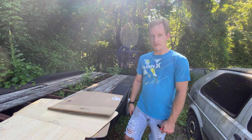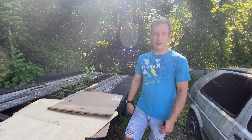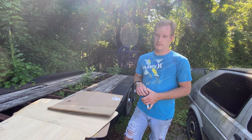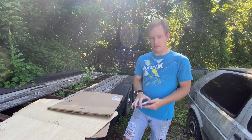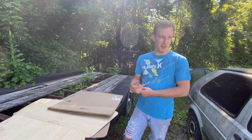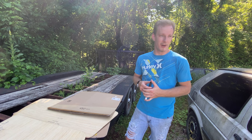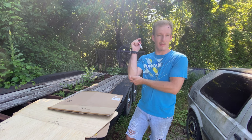And there's the whole problem of floor. Were we going to take the floor from the convertible? Oh yeah. It needs a little bit of patching. But interestingly enough, the floor out of the convertible is going to be stronger than a floor out of a hard top. It's thicker, because there's no roof. Yeah, the rockers are completely different, so there's going to be a bit of mockery to make the rocker look like it's supposed to. But yeah, it'll be the strongest Caddy that anyone's ever seen because it'll have convertible floor and rockers, which is fine. I'd rather it be stronger anyways for putting stuff in the bed or for towing stuff with.